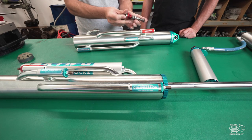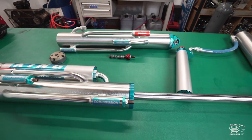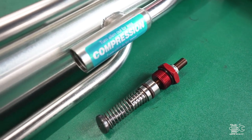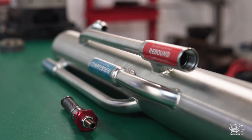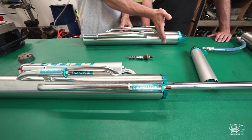These things are so cool in terms of what you can make a car do with a few turns of these tubes - there's a lot of adjustment in them. In simple terms, the lower end of the shock you can tune soft, and as it comes up it gets stiffer and stiffer. Essentially: soft, stiffer, stiff. One rebound tube isn't really enough for a race car, but for any road-going vehicle it's perfect - it'll allow it to be nice and free and won't throw you around, or you can tighten it up.